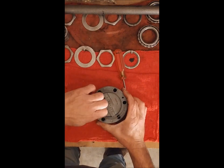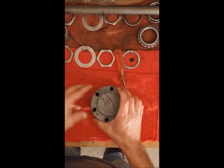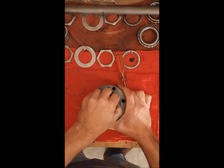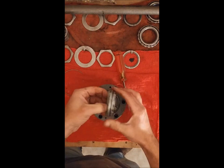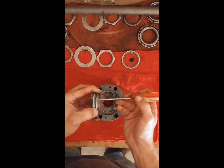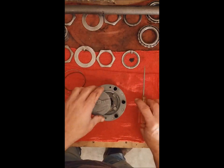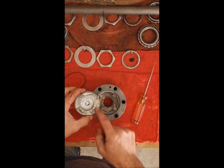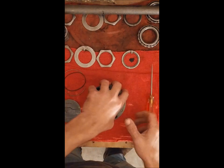Once you've pretty much got it up, you can almost just twist it right out. Obviously be careful that you don't bend it. The cap should come straight up. This one still has the seal on it, which can also be taken off. Lay that aside right along with the cap. You can see how these engage the pawl levers, which engage or disengage it from the spline.